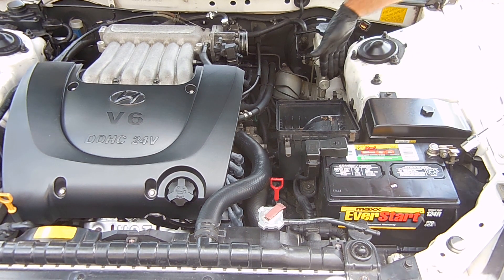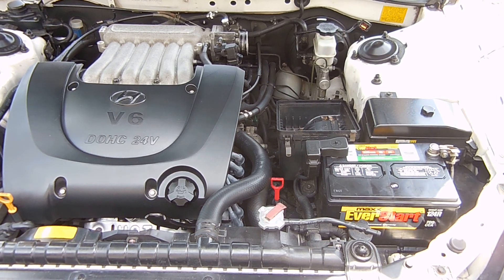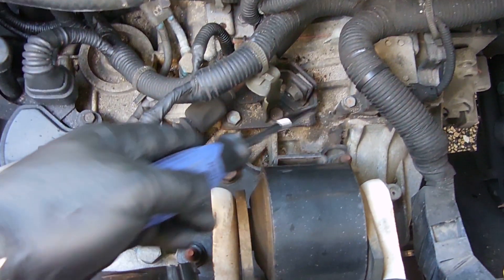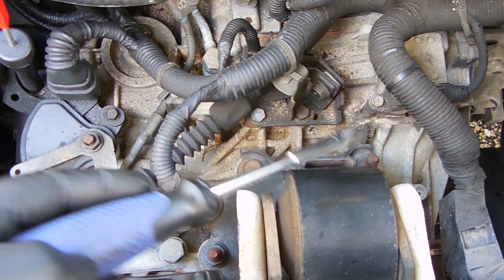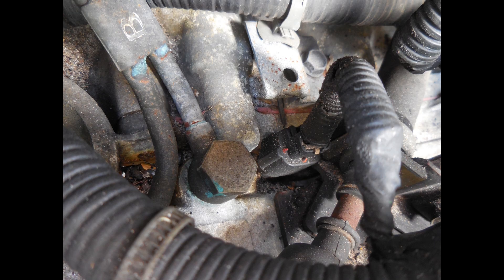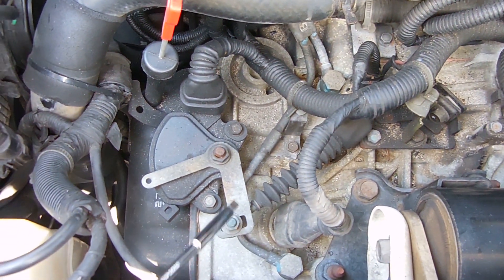Using the ratchet I'm going to remove the three bolts that hold the lower portion of the filter housing in place. In addition to the filter housing, I'm going to remove the battery and battery tray — it'll make it very easy to see what I'm doing. Now the area is all clear, and you can see right over here the sensor I'm pointing to — that is your output speed sensor, further from the engine.